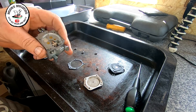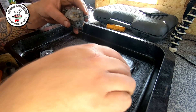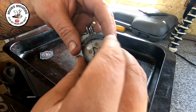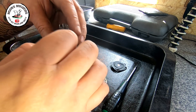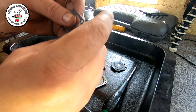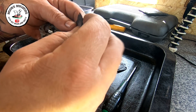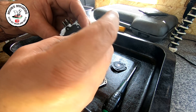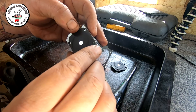The needle is actually working — you can see it is just lifting as it should do. So that's fine. This carburetor is really really clean, I'm very happy with it. This gasket only goes one way — there's a little tiny locator for it. That sits on there. But wait — there's another hole there, and that gasket and diaphragm is missing a hole. It's not quite the right gasket and diaphragm set for this. It doesn't fit quite right — but we can make that fit. Let's have a look at the old one and see how it compares — exactly the same, so there's been a differential in this gasket set.